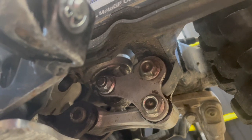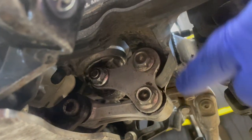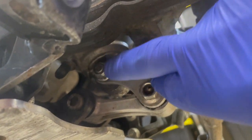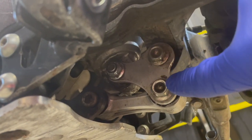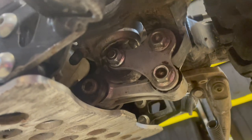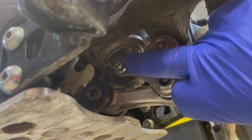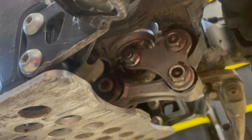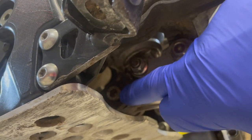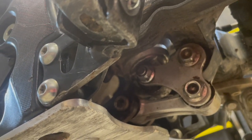And it's always a good idea to take a picture of what you want to work on, so you remember which way the bolts go. All those three bolts, as I recall, 1, 2, and 3, are exactly the same. The difference is the way you mount them. This one goes in this direction, then you have a nut on the other side, same for those two, and the one on the top, which is connected to the rear shock, has a nut on this side. And this one here is completely different. It just has an Allen head over there, but the same nut.